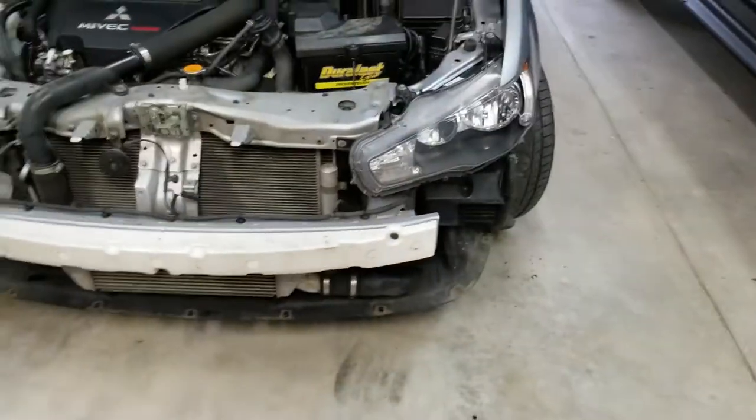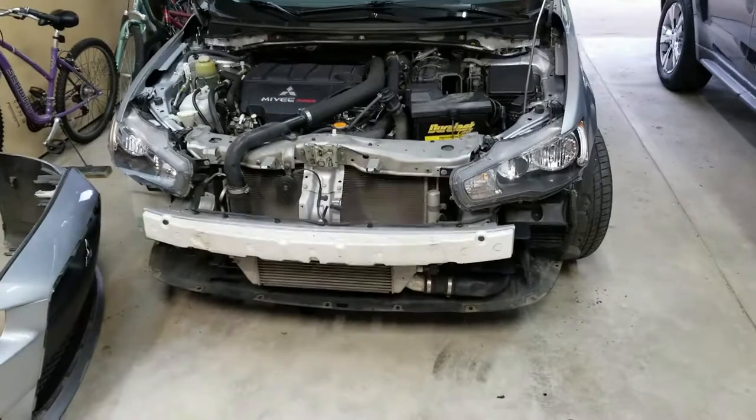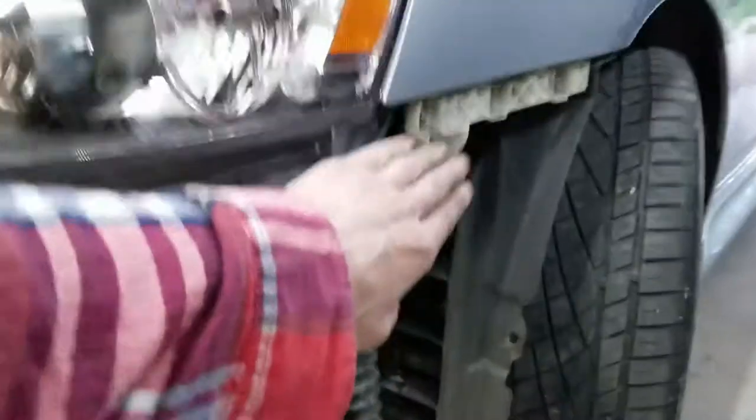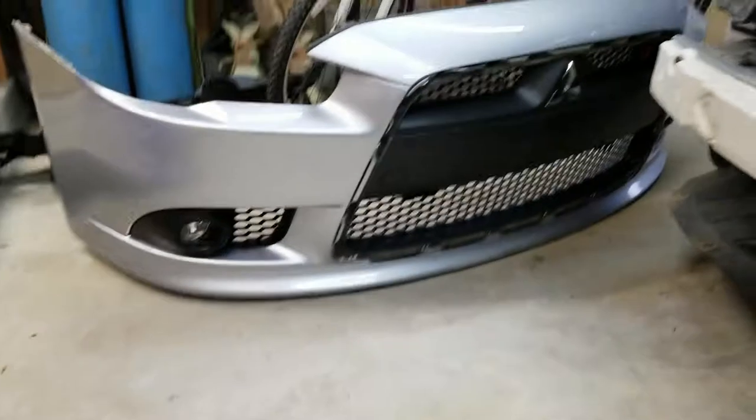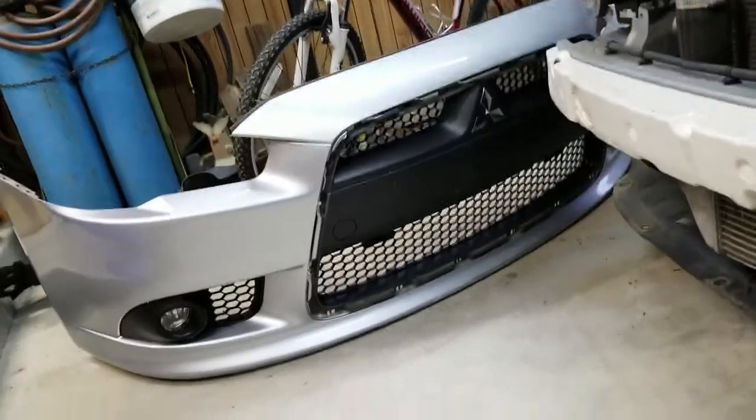I had to turn my head around to get under the car. So, the bumper is off the car. There's a whole bunch of bolts down here, some in there. These clips are kind of a nightmare — you can look up videos on how to do that. There's also a little clip for the fog lights. There's the bumper. It's hanging out a little more without its grill thing. It actually looks kinda cool like that, in a terrible way.